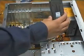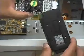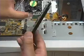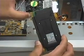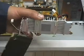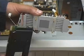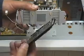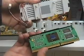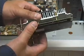Now that our motherboard is installed, we are ready to install our CPU. This is a Pentium III processor, and it comes with its active heatsink cooled by a fan. The heatsink comes with 4 legs, for which the Pentium III cartridge provides the locking receptacles. I put the actual heatsink into place by pressing the 4 legs through the card. This goes very smoothly and fits perfectly.